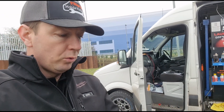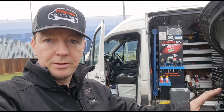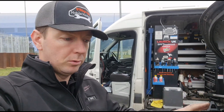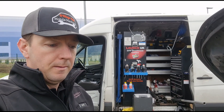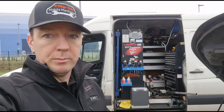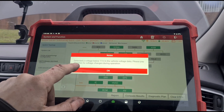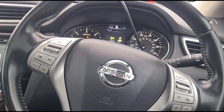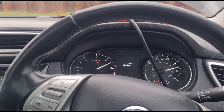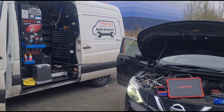With this one, it's not mandatory for me to do a diagnostic test if someone wants glow plugs fitting — if they just want glow plugs fitted, they can have that. I'm not saying it's going to fix whatever other issues you've got, but there's your price. With DPFs, I'm not going to clean it without a diagnostic assessment because nine times out of ten you'll be back complaining the light came back on. We've determined three out of four glow plugs were not working. Now we're just going to clear the fault codes, start the engine up, pack up our tools, and I'll see you on the next video.